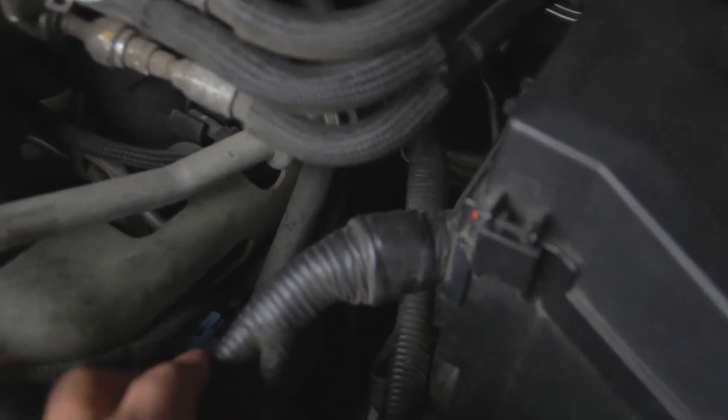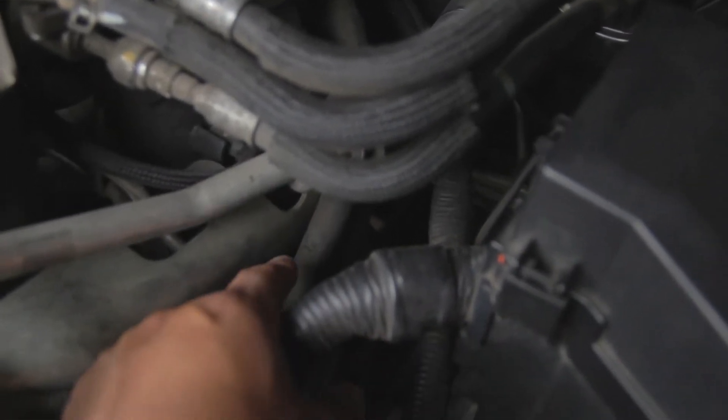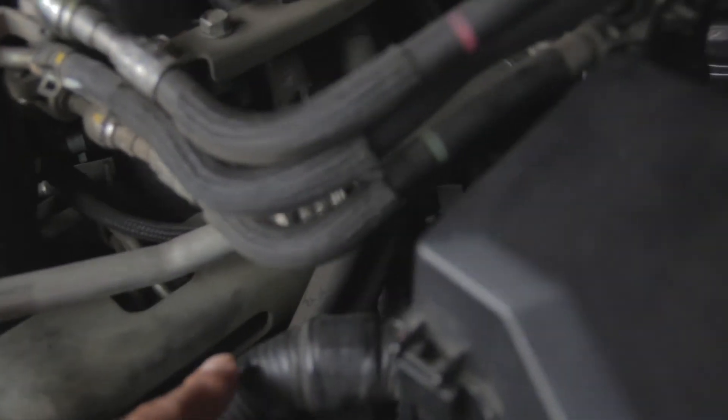What's kind of different from the old pre-2010 Legacies and pre-2015 WRXs is there used to only be one air hose here — there's actually two now, and one of them has a hose clamp. You're supposed to use special hose clamp pliers. I couldn't find any at Harbor Freight or AutoZone. I've taken them off before with a screwdriver and regular pliers — it's a little bit of a pain and sometimes they can damage the clips, so we'll see. The instructions I have are actually the manual the dealership uses to service these cars.